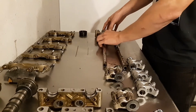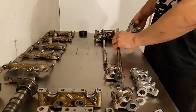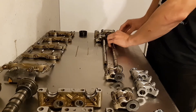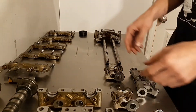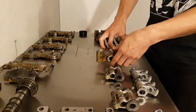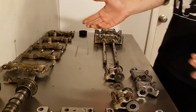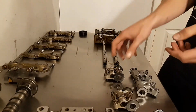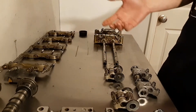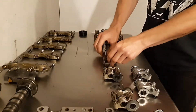Pretty much no matter what, unless you get K24 Z3 rockers, they all have to be modified in some way to fit. Before I made this video, I put everything together and then checked what all was making contact, and I'd suggest you guys do the same, because there's a few different versions of these rockers, a bunch of different styles you can use. Whatever you get your hands on, just do some research, make sure it's going to work. Check your clearances beforehand.